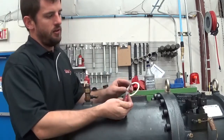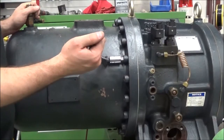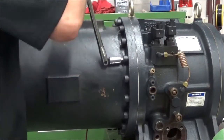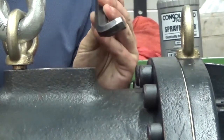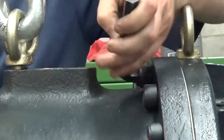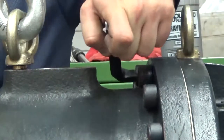You can do this using a pick. Using a breaker bar, we're going to loosen all the bolts on the oil separator flange. In order to access the bolts that are on the top near the discharge port on the compressor, you might need to cut an allen wrench to fit in here. That way, you can loosen the bolts.